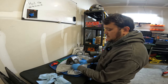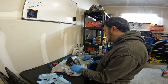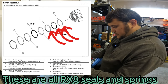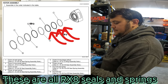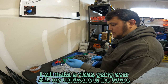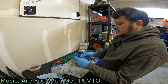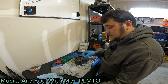I've made a little workspace with a plastic tray so I can spray cleaner without it soaking into the table. What we're going to do is start by assembling the smallest oil control ring. I have a spring, which is directional — I'll talk about that in a second. I've got the smallest control ring; there should be four total, two of different sizes. And then we've also got the O-ring that matches. Just so you guys know, these O-rings don't just fit right in — we're going to have to work on this.